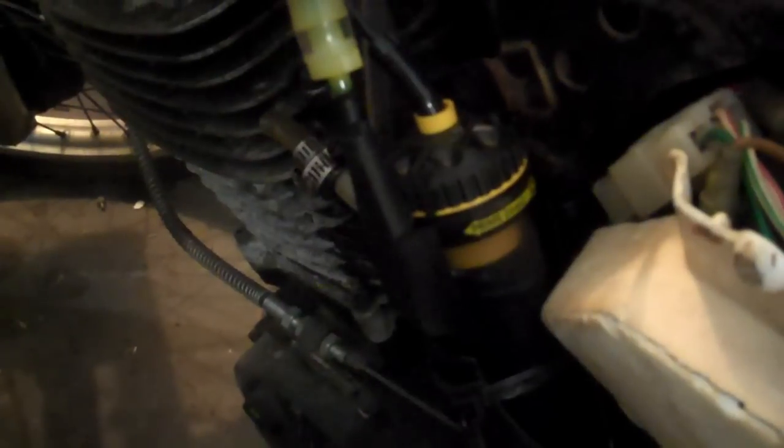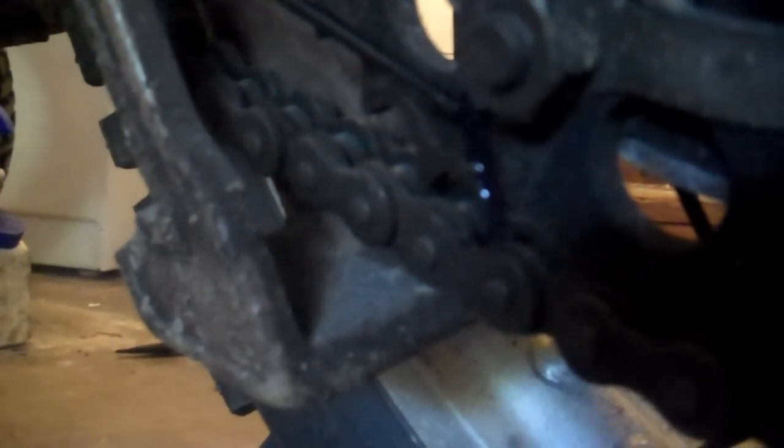So to prime it, what we do is we turn the dial all the way clockwise, and then we're going to use the rubber attacher thing here to connect to the hose of the fluid, and we're just going to force fluid all the way down. You can see I'm forcing it. It's just going to come all the way down there until it drips out, and there's no more bubbles left. So there you go. You see it just sort of dripping down like that. That's what it wants to look like.